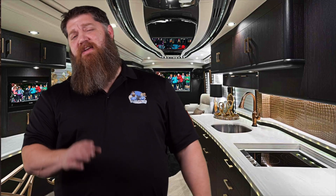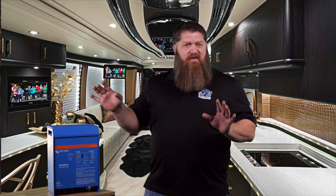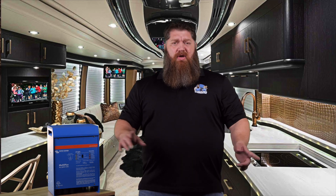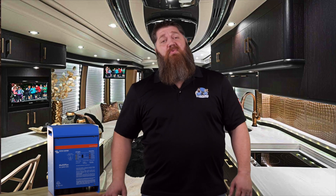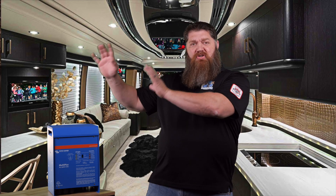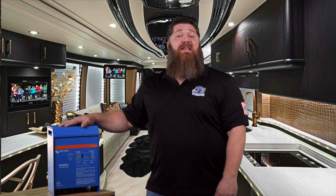So you want to try out one of these Harvest Hosts or boondocking setups, and you go ahead and set up your rig. You know you've got batteries, but have you ever noticed that your outlets don't work? Your air conditioner doesn't work, and the only things that do work are your lights, your fan, maybe your water pump. You wonder, wouldn't it be great if I could watch TV or have air conditioning at this free site? What do you need? We need to take that 12-volt power and make 120 volts — that's what an inverter does.